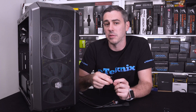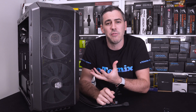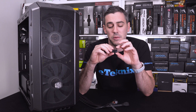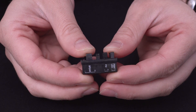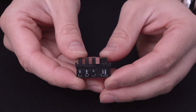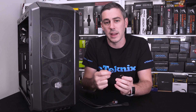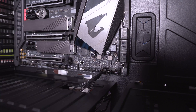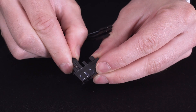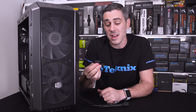Sometimes the text will be facing up, sometimes the text will be facing down. Now, what some motherboard manufacturers have done — and something I quite admire them for — is having a single connector. This one here is from a Gigabyte board which we have in this system. They call it the G connector; other people call it the Q connector. Whatever it is, it serves the same purpose. On here you can see there's an area for the speaker, power, and power LED, and flipping it around we have hard drive, reset, chassis intrusion, and power LED again. What this allows you to do is put everything in outside of the chassis, so when you come to place it onto your motherboard it's just one easy swoop. For example, for the reset switch, you find it here, make sure the plus and minus line up, and simply slot it into the connector. Once that's in you continue with the rest and then simply put the whole connector onto your motherboard.